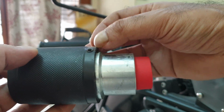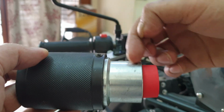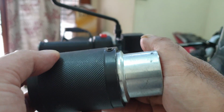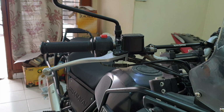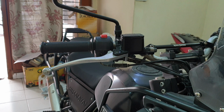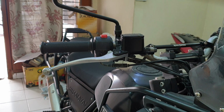And the oil, let's say this is where the hose gets connected, keeps pushing in, filling this space. So all we have to do is push this piston back in and make sure we are sucking the oil out with something so that it does not spill anywhere. I hope I am making that point, so that we have less oil to drain in the process of flushing and bleeding. We can straight away start from here like the normal process, but that just wastes some bit of fluid. And I think it is quite clear now that I'm a pretty stingy guy when it comes to these kinds of things. So let's continue.